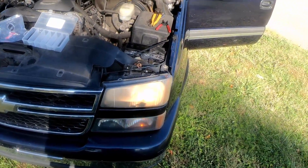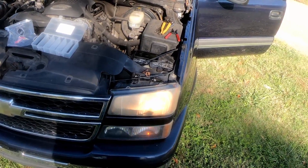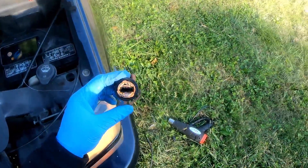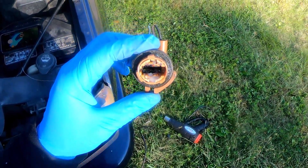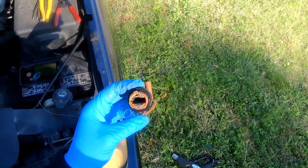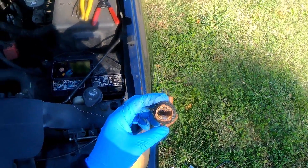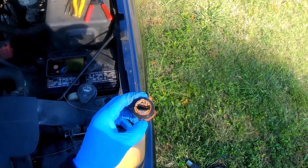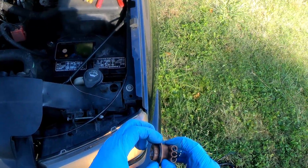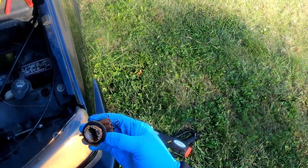As you can see, got it back together, everything's working fine. Now, I'm not sure what caused this to burn up, but I would imagine moisture got in there and shorted the socket out. It's a good thing that we caught it early, because it could have caused a vehicle electrical fire. Interesting — it has a gasket on here, I'm not sure how the moisture got in there, but it did. Something got in there to short it out.